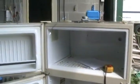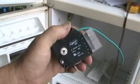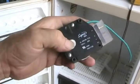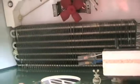Now the most common problem with fridges that's electrical, period, is the complaint that my freezer's cold but it's got ice on the back, but my fridge is warm. That could be an issue with low Freon, but here's the problems it has when it's an electrical problem. Most common problem, timer stops running, but it stops running when the fridge is on the running cycle, so the fridge just sounds like it's working normal and cycles off and on until it gets to the point where it can't cool the fridge anymore because there's such a big ice blockage on that cooling radiator back there that the fan can't blow any cool air down to the bottom, like I explained before, that comes out that hole.